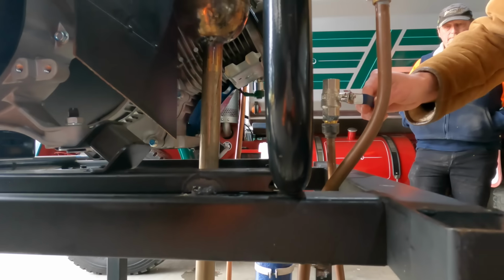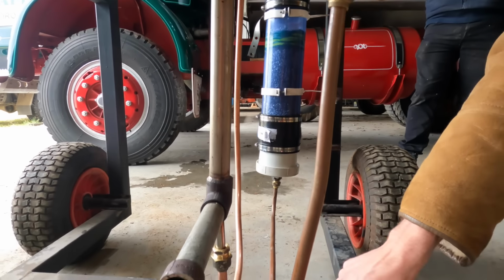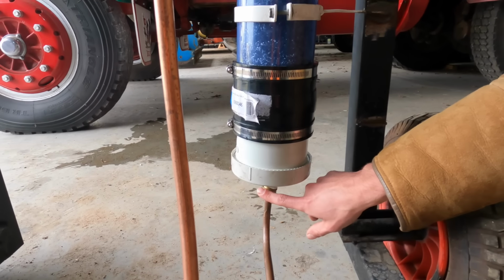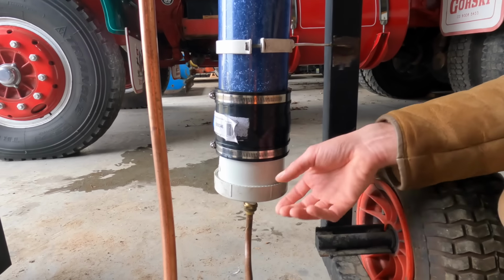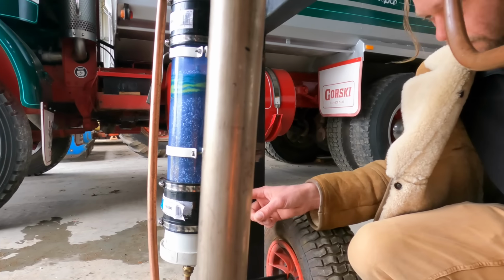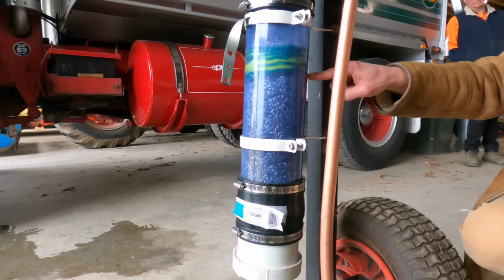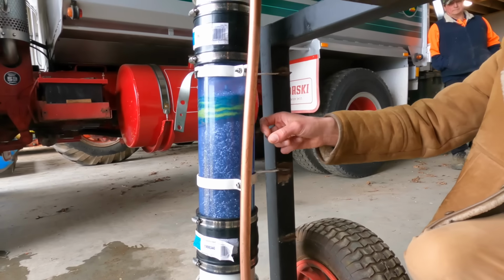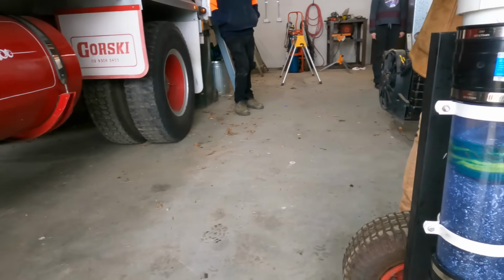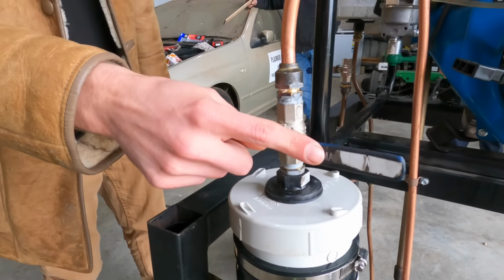We've got this little filling valve, to put the water in or whatever you're putting in the bubbler. Then you can see this pipe continues down here, goes into the bottom of the bubbler, and then we've got this air stone in here that's going to micronize those bubbles and send them up through here. This is all happening because of the vacuum from the engine's pistons, as we've already explained in the last video, so I won't go through that too much. But then our air gets pulled up through the water and the stainless steel wool catalyst here, up through this mesh, vacuumed right up through here, and then this is where we've got that valve just to start the engine up and then turn the unit on afterwards.